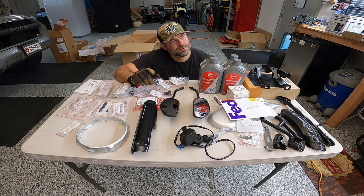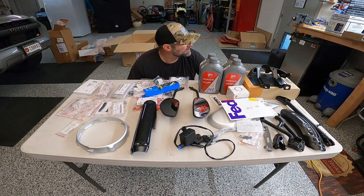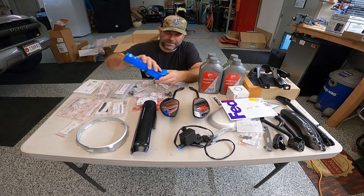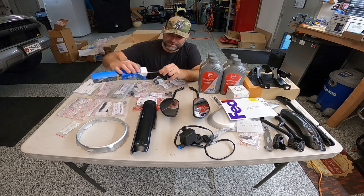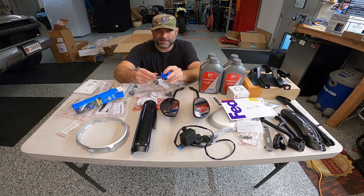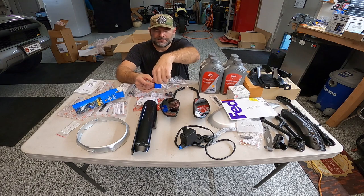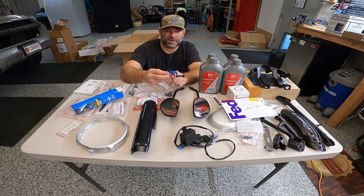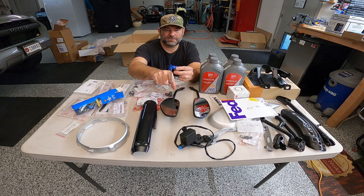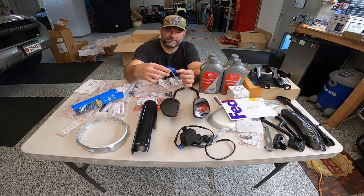I got a pretty cool tool from Motion Pro, let me show you guys this tool real quick. You can use this on pretty much, oh man, I broke the damn thing. You can use this on any bike, anything that has a chain, honestly. It's pretty simple: you tighten this thing down onto your chain, and then you put your rod in here, like that. Basically, once you put this on your rear chain sprocket, it goes up to the sprocket, and it'll tell you if your chain's off, so you adjust your rear wheel so the chain and this are in line with each other. You can use it on 50cc's, your 450s, any bike that has a chain.